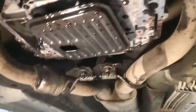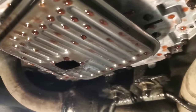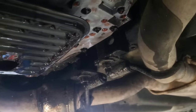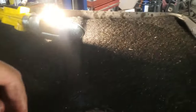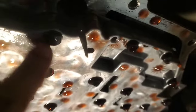The pan is down now, and this is what we see. Next thing we've got to do is get this filter off. It has these clips that you can get with a screwdriver, or take that torx nut and loosen it a little bit and pull the filter out. That just dropped right out. One thing to make sure of: check that the o-ring came out with the filter, because you don't want to put a new o-ring on a new filter and still have the old one up inside there.